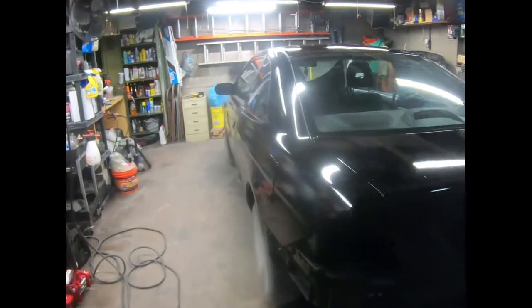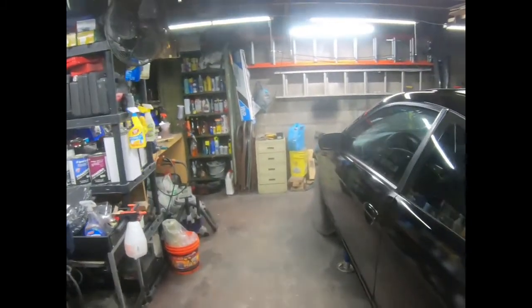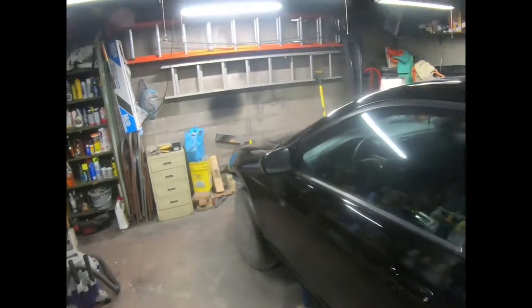And there you have it, people. That's a wrap. Only mistake I made. Look, see, always got bugs. Ain't no roach, y'all. The only mistake I made is when I should have just waited to take the plastic off the sunroof, because when I was getting down, I hit right here. I rubbed up against here and all this stuff is still wet. So hopefully, I don't know, y'all can see, I just threw another little coat of clear over there, because I know how to fix it. Only way I know how to fix it permanently is to repaint this whole section and re-clear and everything.